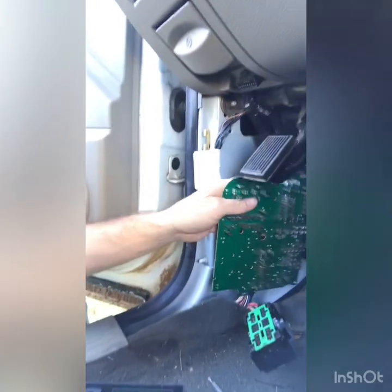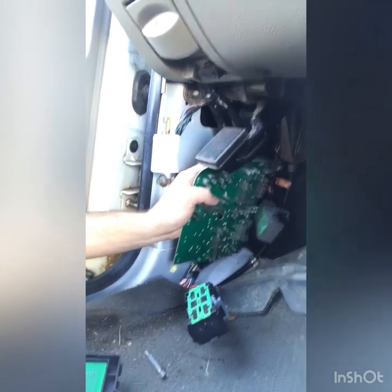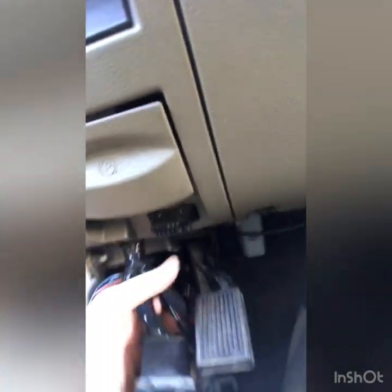I've got it broke down here. This is your fuse box — it mounts right over here and has all your fuses in it. I've done this repair several times. I found where the water's getting in — it's actually jumping. It's coming down, jumping under here, originally coming down here onto this and running down these harnesses right into the panel. What happened is the instrument panel was just going crazy. So if your instrument panel just starts going crazy after you go through a car wash or there's been a hard downpour, this is the place to start looking.